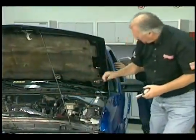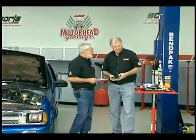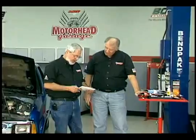All right, bud. Well, David, that's not bad. Got 2 cylinders that improved a little bit, and we haven't driven this very far, so we put some miles on it. We'll do an oil consumption check. Not bad at all. Yeah, check it out. So we got what, 160, 150? Yeah, so we got a couple of increases in a couple of cylinders, so that's not too bad. So that ought to work out pretty well.